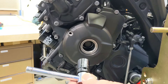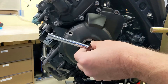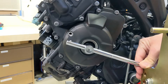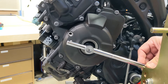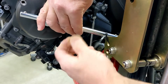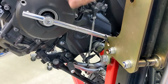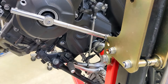This might be overkill, but I'm setting up a safety procedure by putting this 19 millimeter on the crank bolt, then I can slide this arm out like this. I'm going to get a zip tie and put it through this hole — that's my ten dollar Harbor Freight to-the-rescue tool. It seems to be holding. I'm looking in this hole to make sure I didn't move it when I was zip tying.